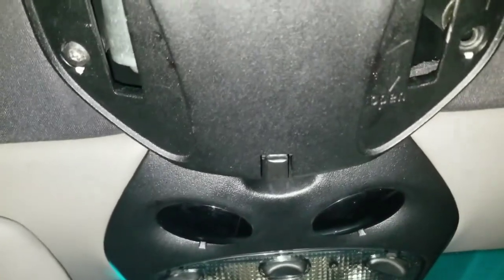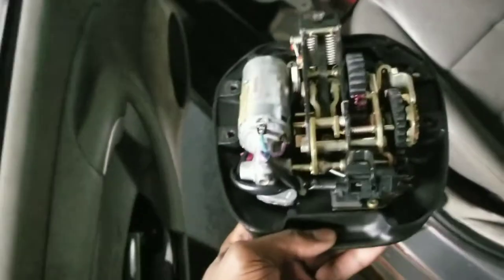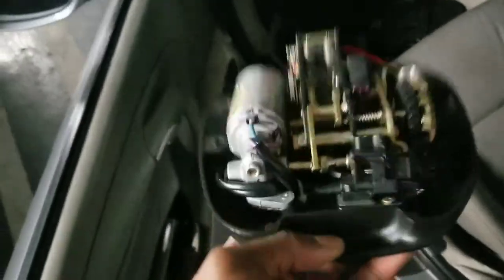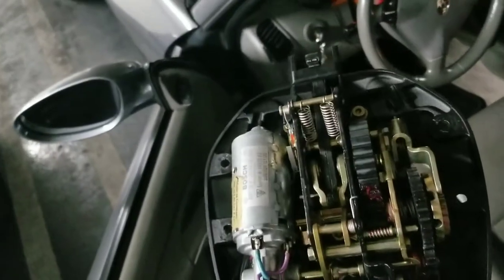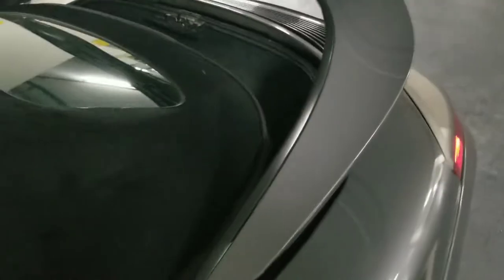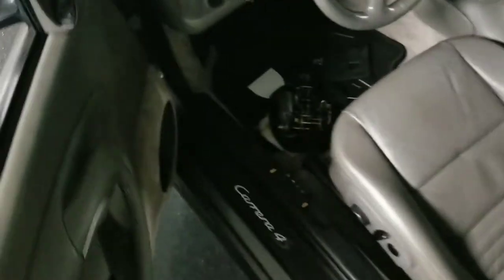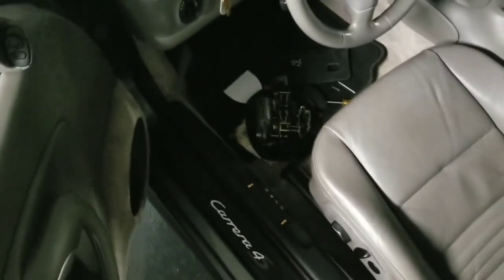To note, the issue is that the clamshell is not working, or the clamshell is not actually opening, and I think it has something to do with the micro switch. So, after removing this piece, I have the entire assembly out after a couple of clips, and I was worried about the clamshell not working, but when I took it off and I hit the button, look, boom, automatically this back piece opens up. I'm going to try to pull it down manually, and then we're going to do some more investigation into this micro switch latch situation.